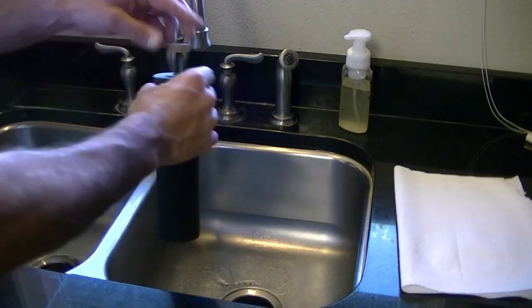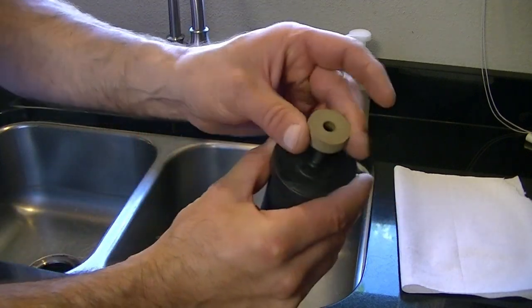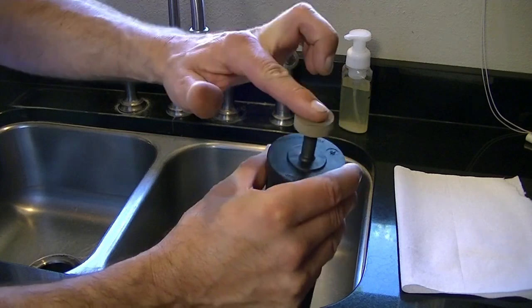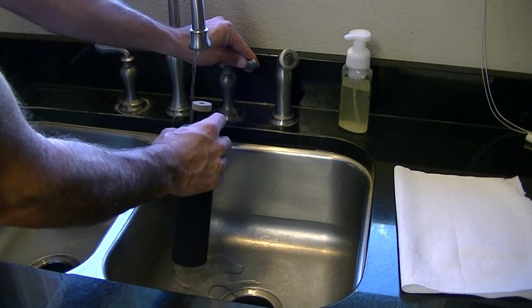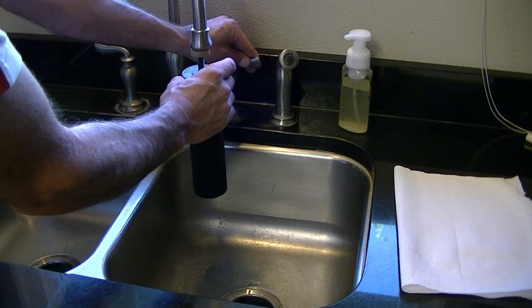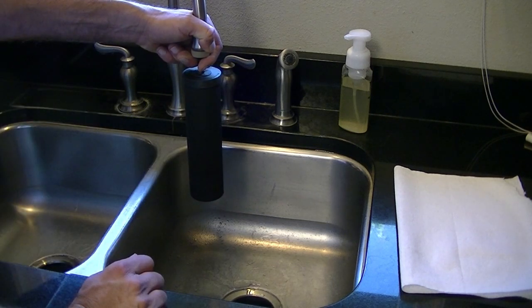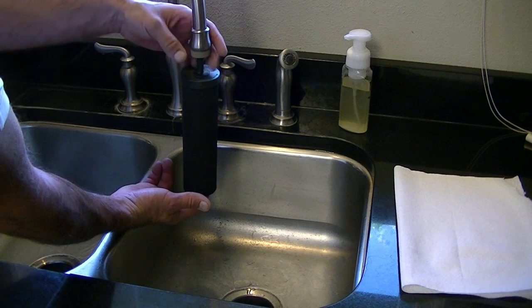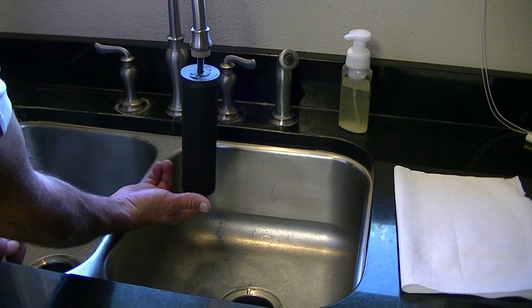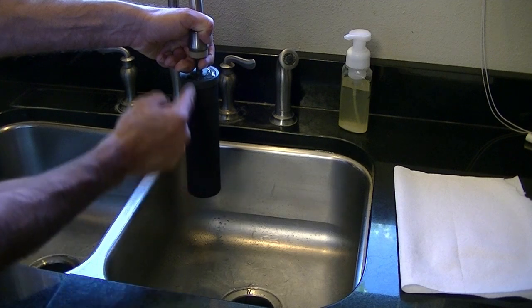To prime it, it's really simple. There's just this rubber plug with a hole in it that goes in the top of the filter. Now we're going to press the faucet up against here and just let cold water slowly run in. I can hear it right now filling up the element. We're supposed to do this until it starts sweating on the outside and then it's clean. I'm going to watch the side of the filter for little sweat bubbles.